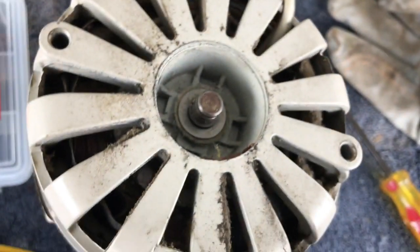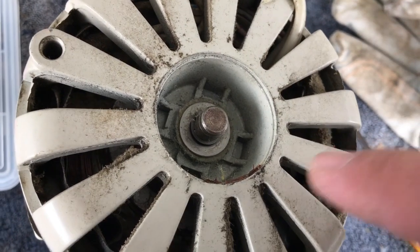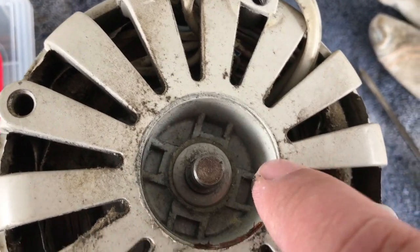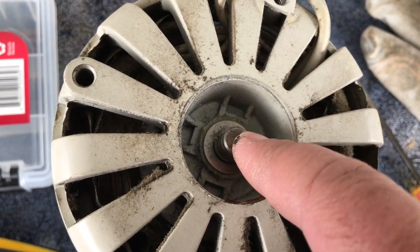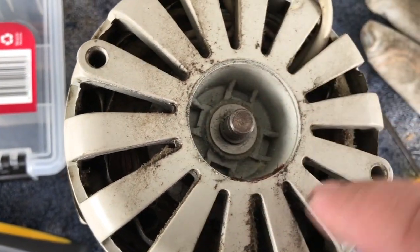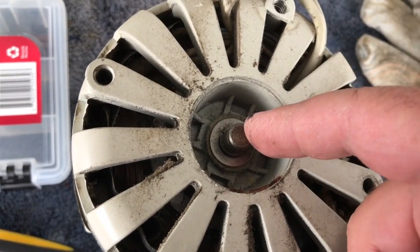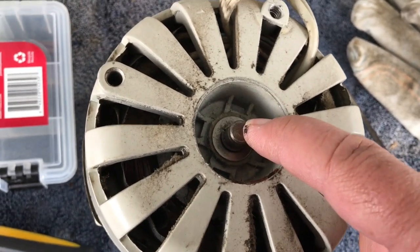One of the things you'll notice is that with the old fans, the metal bladed ones, they have a big felt in here, and the way it's designed, and little felt, see these squares? On the old fans, there were felts that ran all the way through to the other side of the bearing. And what it did was, it would cycle the oil back and front, back to front, back to front, because there was an oil groove on the shaft. This doesn't have any of that.